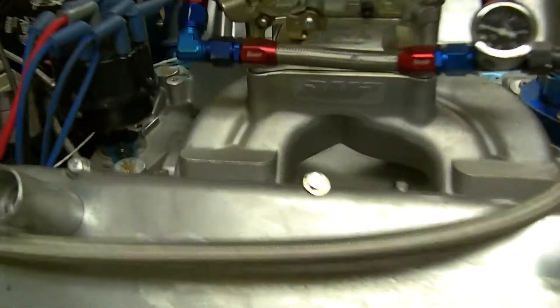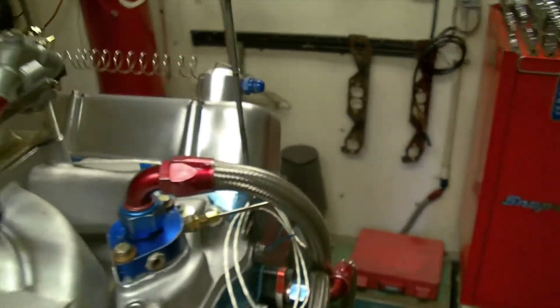I'm going to give you some pictures here — let's take a look at it. These are just my test valve covers. As you can see, there is no blow-by, no crankcase pressure coming out of any of these holes. I have no air pump on it.